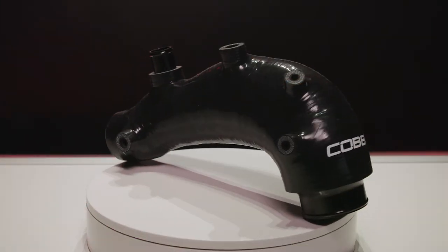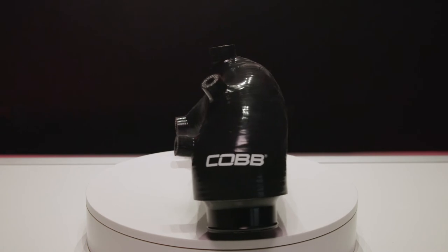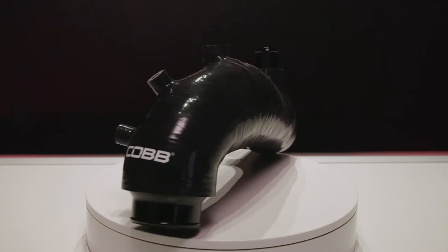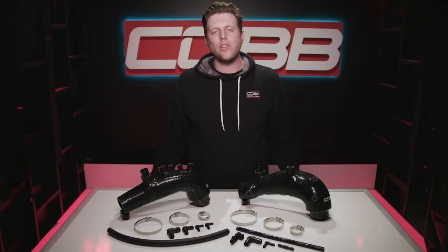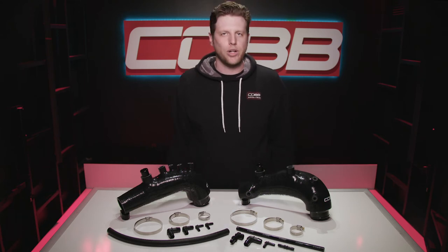It's friggin big. It has far more total volume throughout versus stock or any of the other aftermarket versions I've seen, and that really does help performance. You're not going to see massive gains just from a turbo inlet, but we have seen legitimate and repeatable increases in power specifically due to changing this part alone — it reduces pressure drop before the compressor housing, and that improvement on the inlet side has a direct benefit on the hot side, helping with spool time and throttle response.